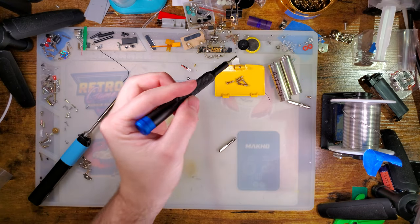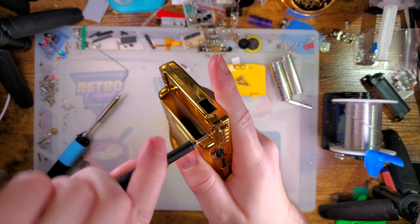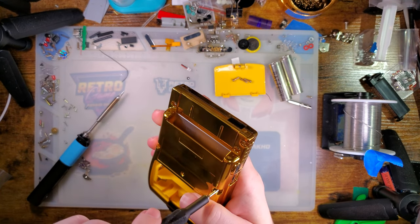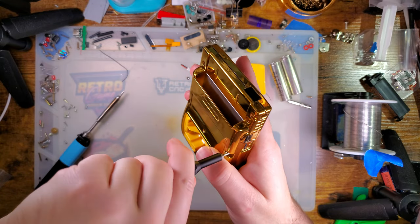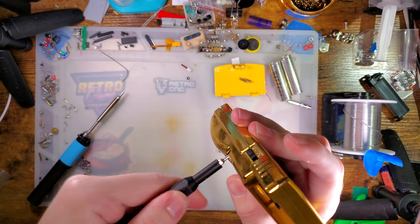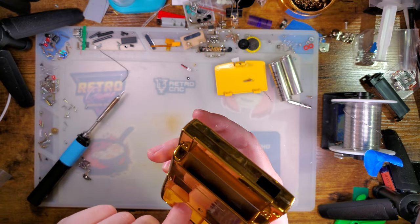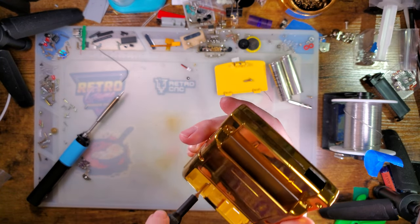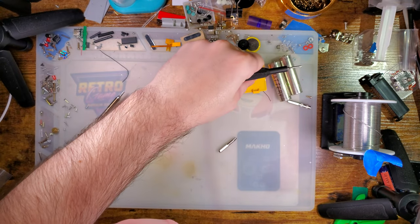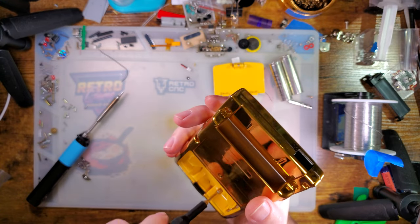And because we're doing plastic into plastic, we don't need to crank these screws down as tight as they'll go. My preferred method is to just bottom them out and then back up like an eighth of a turn. I think that was closer to a quarter turn, but same difference really. This will help preserve our threads and ensure that nothing's over tightened to the point where it's gonna crack just by handling it funny. I have yet to crack a screw post or anything like that doing this, so maybe it's confirmation bias, but at the very least, it seems to work.